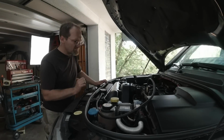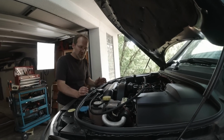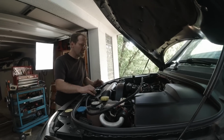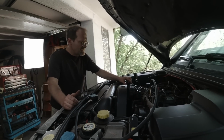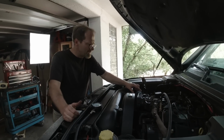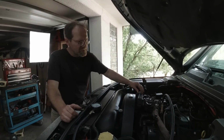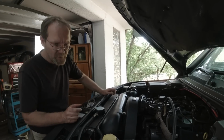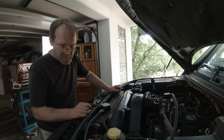So apparently that fix worked. And then we were still concerned about the oil pressure, which was low for no particular reason. He did have one hose clamp fail in the meantime, and the car went into limp mode from the air intake, which was the lower one down on the bottom, and basically the hose clamp was a cheap clamp. Other than that, from the engine side, I think this thing is ready to go.